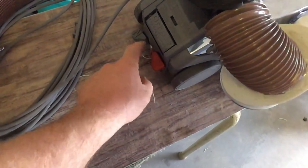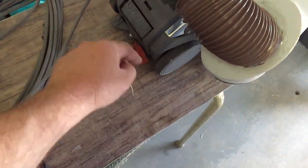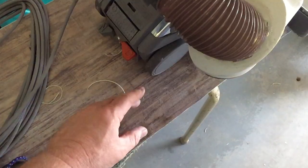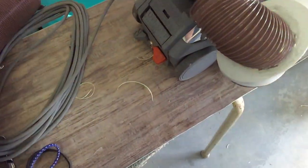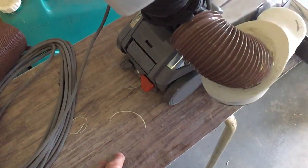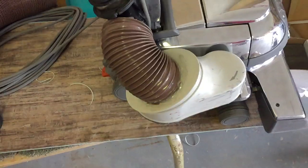The other thing that makes this really neat is this device right here — it's actually a transmission, and the wheels are powered. When you're vacuuming all day long, having a machine that powers itself is so much easier on you physically. A slight amount of pressure on the handle pulls it forward; slight pressure backwards pulls it back. There's virtually no effort to moving this vacuum across the carpet — I think it's about two pounds of pressure to move it.